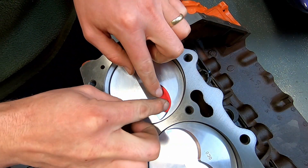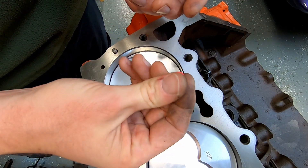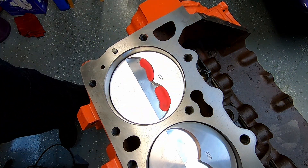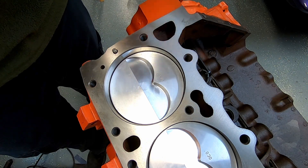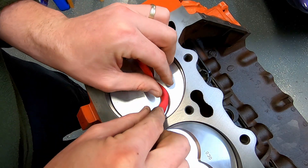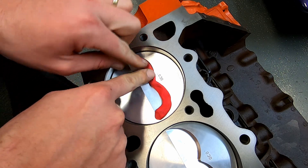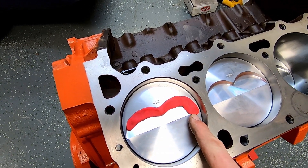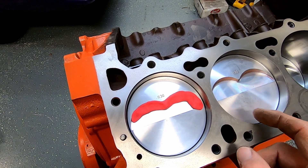Now let's get my piston-to-valve clearance checked. I'm going to go across right here — you don't have to have a ginormous piece, but I'll grab a couple of pieces. Ed at Ed's Machine told me it's nice to use soft clay or Play-Doh so that the hardened stuff isn't too hard. I can lay a long piece across here. I'm only able to check one at a time anyway, and if you do it wrong you can redo it — it's not a big deal. These are 8cc valve reliefs cut into these pistons — they're symmetrical, same size, there's not a big and a little.